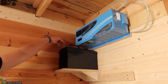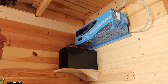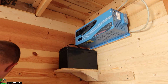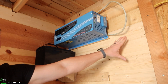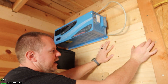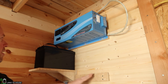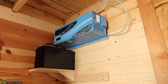The terminals are pretty close back here, so I can probably get by with maybe one-foot cables, to be honest — I'll have to order those. This inverter wants 4-aught cable, so some massive cables to go from right here to right here to get that 3000 watts. The last thing to do is install that charge controller. Since we're possibly going to have more batteries in the future, I'll put that right here. It'll just be a little box, and then maybe off to the side I can put that display. The inverter will feed my panel down here, the battery will feed this, and the charge controller wires will go up and over and hook up to the batteries.